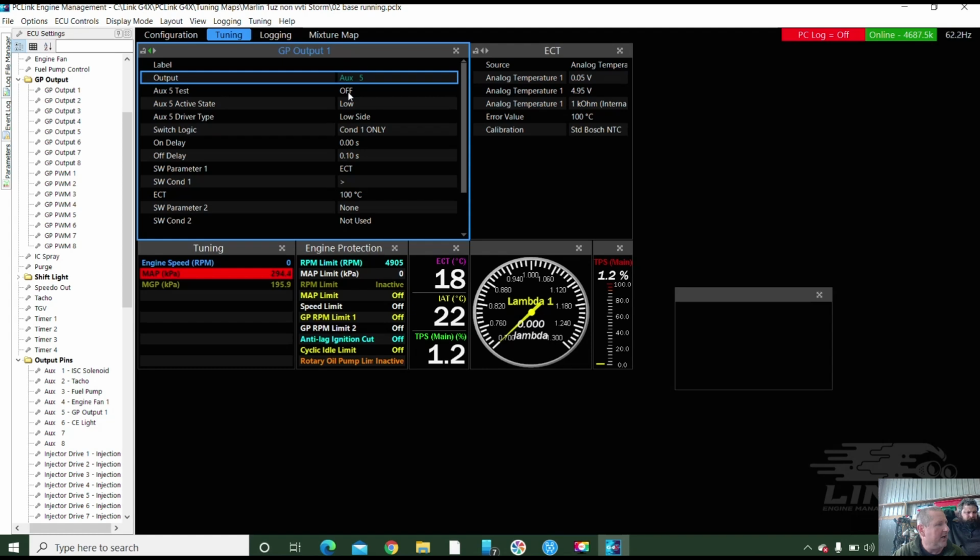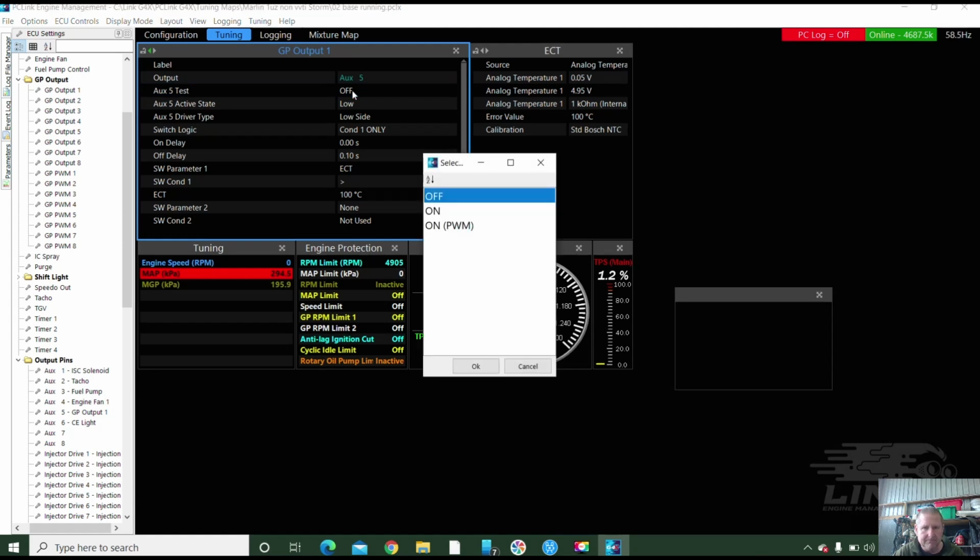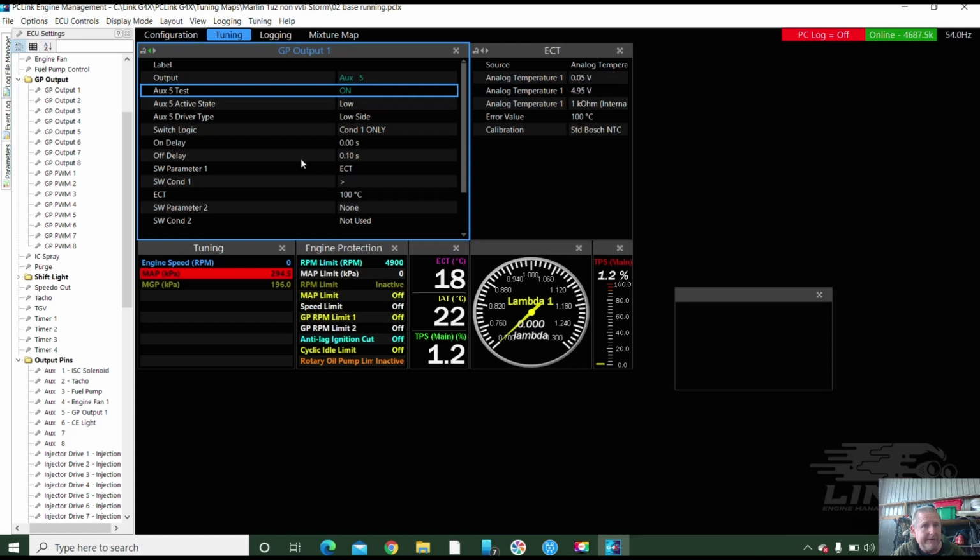Do you know where it is in the body plug? It is an orange yellow. One of these orange ones. That one. It's still in there. Okay. So test light to power. So the little clippy thing on the other end that's presently on an earth, you clip that to a power source. Yep. Pop it into the orange yellow with your test light, and I just turn it on. Is it turned on? Yeah, it's because it's a test light.